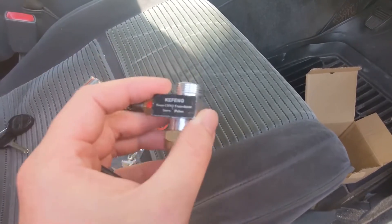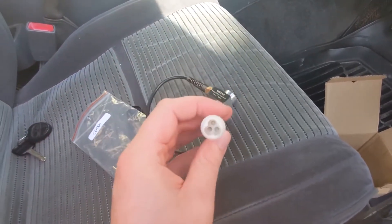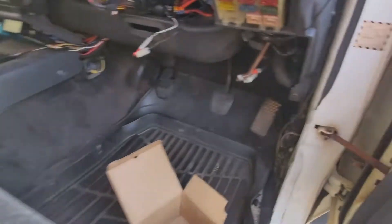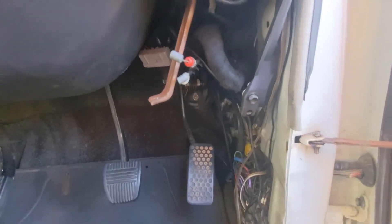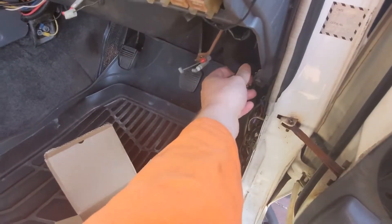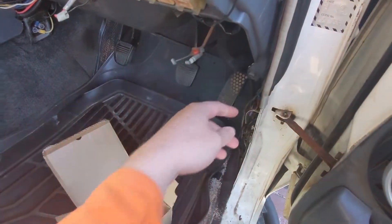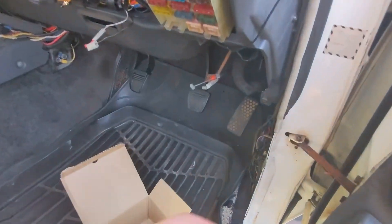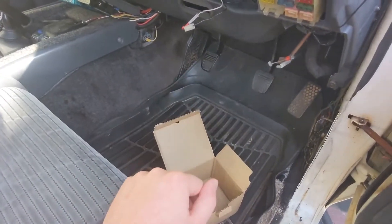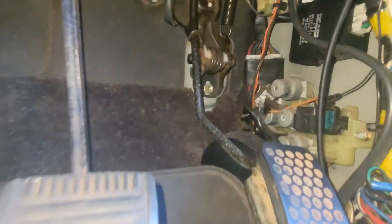All I have to do is chop off the plug, put on the factory plug, and it's pretty much a direct replacement. Unfortunately I've already made the harness all pretty, so I'm going to have to unwrap all my hard work and wire in the new speedo cable signal inside the cruise control harness and wire up to the vehicle speed sensor input on the cruise control computer — because I used a different cable run previously for the old cruise control. A little bit of going backwards, but hopefully it's all for the better.